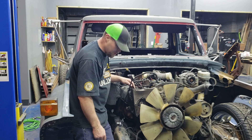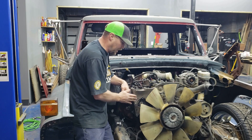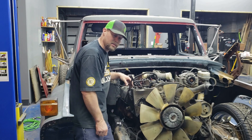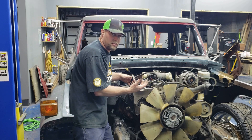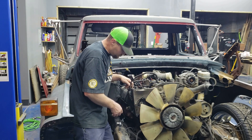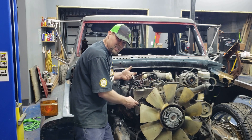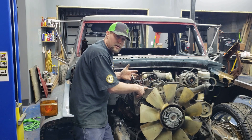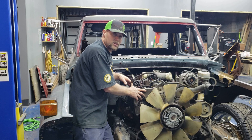I might try to tie it into that stud — it's a valve cover bolt, so if I use it cool, if not that's fine too. It all depends on how sturdy I can get it off of these three. Ideally I'd like one more to tie into. I'm thinking a plate that goes right here and comes directly off, tying in down here. I'll grab some cardboard and kind of see what I like. Basically all I need is a flat plate right here to bolt that compressor to, then get something to line my pulleys up. I'm going to use three-sixteenths plate steel to make this bracket.